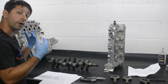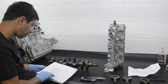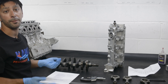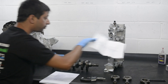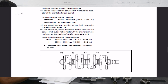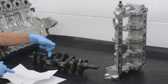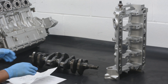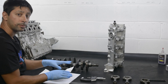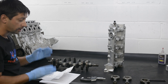On to the crank. The crank is a little bit more complicated — this is the part that most people struggle with. What I like to do is measure the crank instead of going by the mark method. Here are the measurements of this crankshaft. These are the connecting rod measurements up here: rod one, two, three, and four. I will measure one to show you how to do this, but you have to use a micrometer. You cannot use a caliper — any dimension you get with a caliper is not going to work. It has to be done with a micrometer.